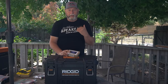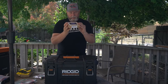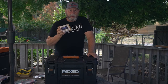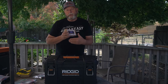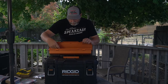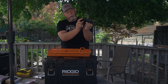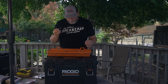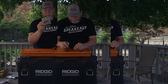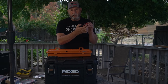The only way to really know your battery charge percentage is to put a shunt in. This is a shunt — not super expensive but it'll do what I want, giving me a battery percentage reading along with solar input data. My solar controller will also be able to report battery status. I'm also going to run a fuse panel, and I bought a battery switch so I can just click it and turn everything off.